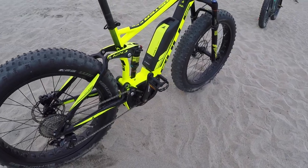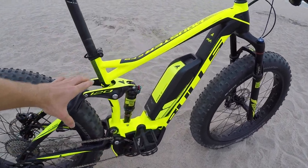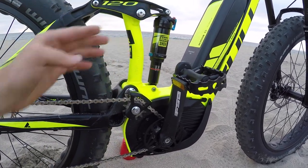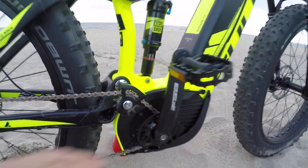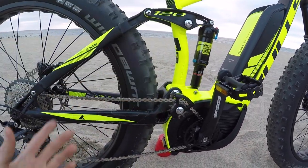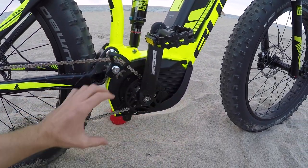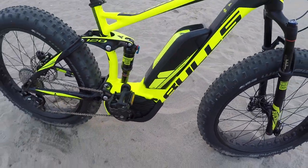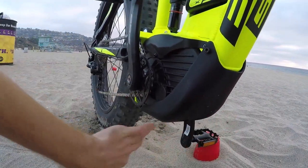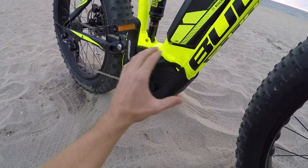Other things I like about this bike are the geometry and the way they've laid it out. They've got that four-link suspension back here, and then they've raised the chain with a little tensioner. The tensioner has a bit of a cover on top so it keeps the chain from bucking too much. It's a narrow-wide pattern, so you're not going to get slipping — it just grabs that chain really nicely regardless of what's happening with the suspension. This is something that Bulls does really well. The Bosch motor is almost concealed back here.